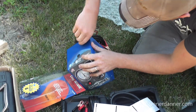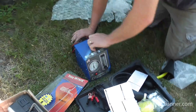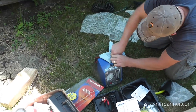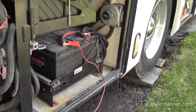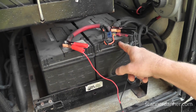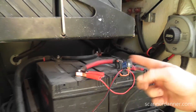The smoke is blowing right at me. I can't open this — it's super tight. Why is it so tight? I still can't open it. Thought you worked out — what the heck, Redline, I need pliers to open this. Get a shot of that — that will not work. Positive to positive — these are in parallel, not in series. That will not turn the smoke machine on. I need to be on the negative. Doesn't matter which negative, doesn't matter which positive.